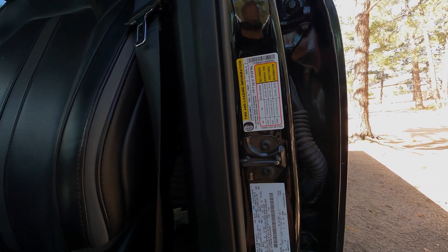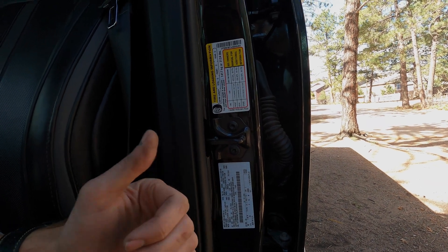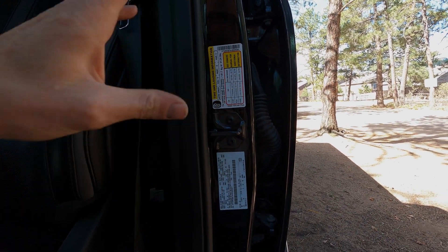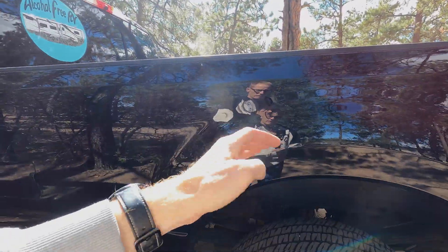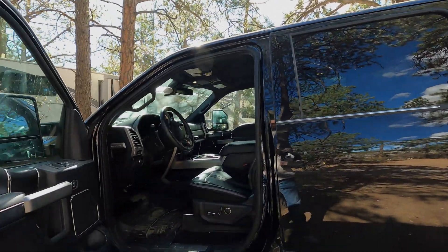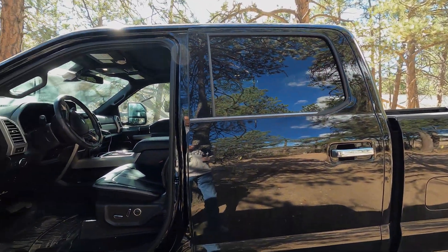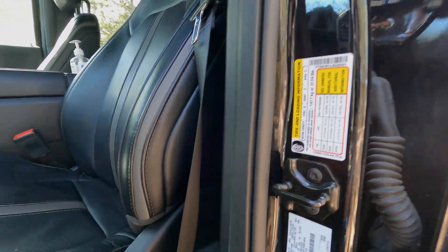You might have a lot of weight on the back and less in the front, so that's something to be careful about — it's not just about the axles and springs. Other components are required to achieve a higher weight rating. For the F-350, a dually versus single rear wheel has obvious differences in springs and axle housings, but also the braking system is different. That's why you can't just put more wheels on the back — all of this has to work together as a system to reach that higher weight rating.